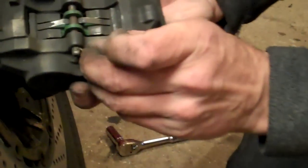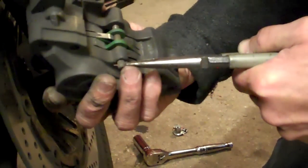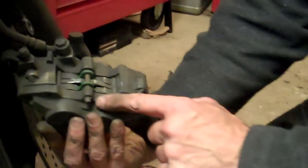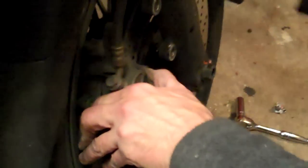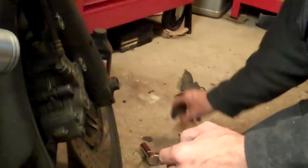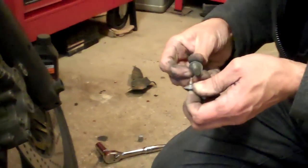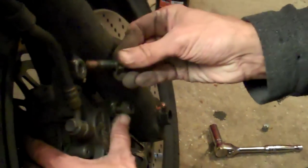Take a split pin, put the split pin back in. I'm going to get some of those little R clips because I don't like split pins. Split pins in, all assembled. Come round the front, open the pads up so you get the big gap in them, spin them back round, pop them on the disc. Now you can, if you wish, spread some copper slip or copper grease on the back of the pads and that will absorb the high frequency vibration that leads to squeaking. But personally I don't often do it because I don't get brakes that squeak.